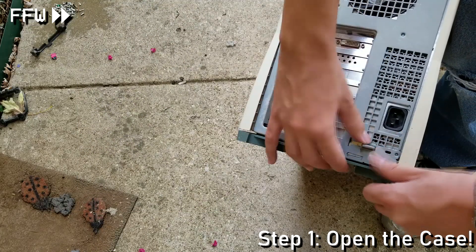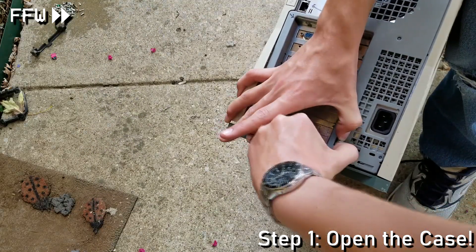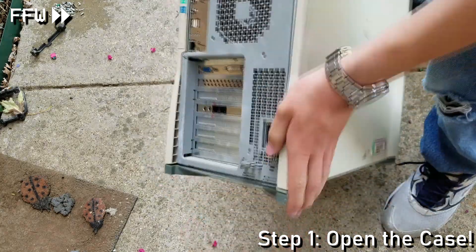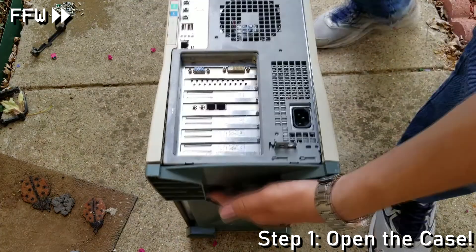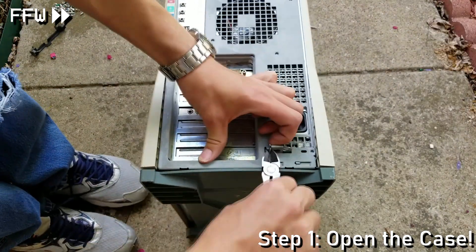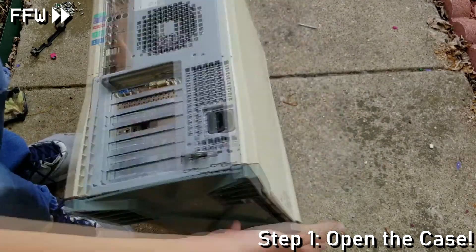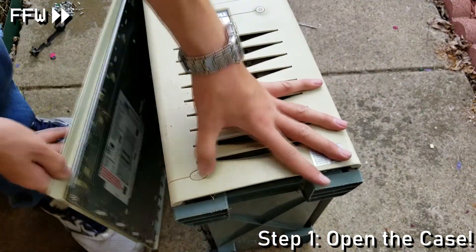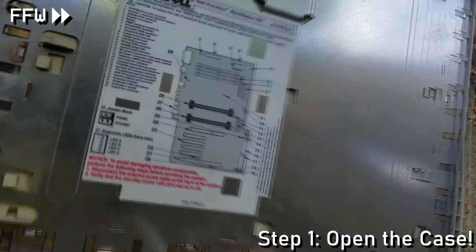As with the other Dell computers we must ensure that the latch is disengaged, which needs a little force to slide out of the way. I'm having a lot of trouble using my fingers, so I employ the use of some wire cutters to try to press it in place. Now that it is disengaged, we press on the button in the front and the side panel pops right off.